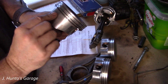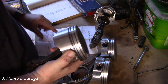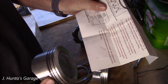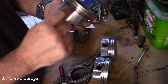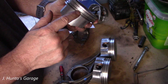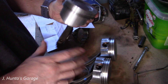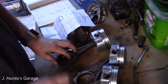All of the oil rings are in. Regarding the gap spacing: please install spacer gap facing the piston skirt — they want the gap in your spacer ring right here, and then your gaps for your oil control rings, one over here and one over on this side. And that's done — all six of them.